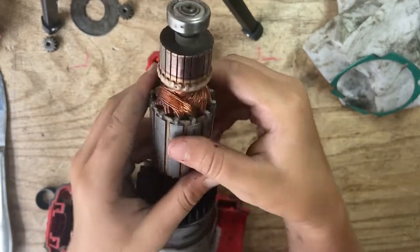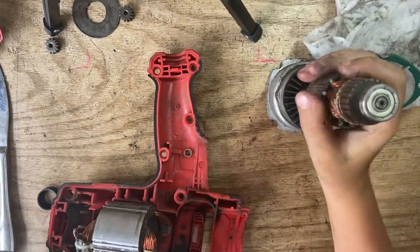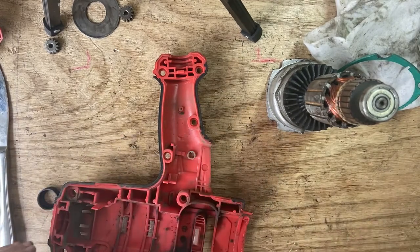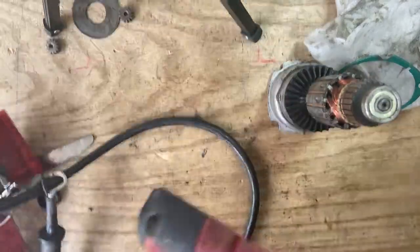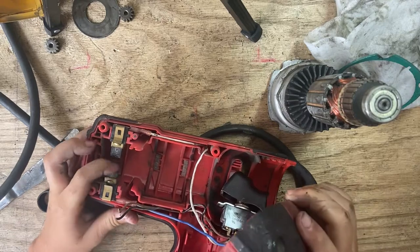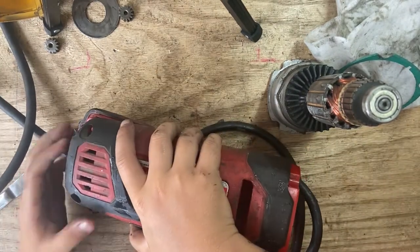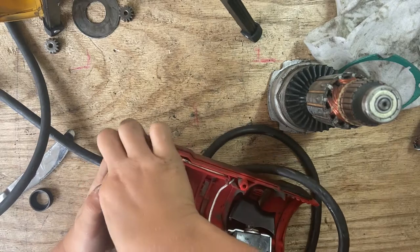As you can see, there are these indents on these metal strips here — this is damage. I cut the wire off because it was getting annoying. Over here in the back, these are the brushes. That was the thing making the 'bing boom' sound, and back here was making those sparks — so it's the brushes. These things can come out.